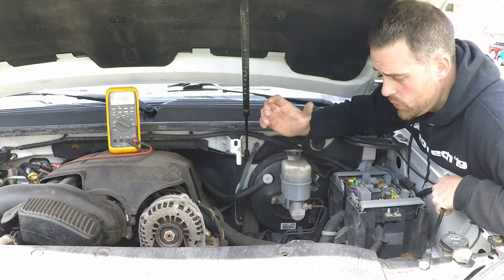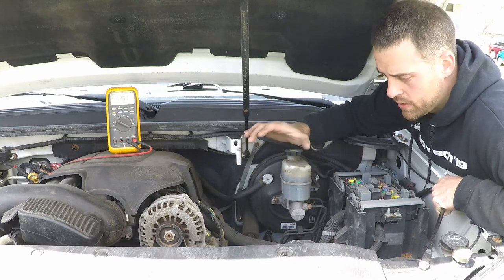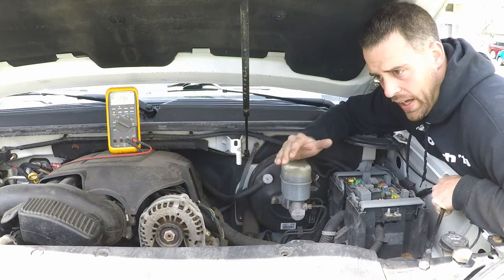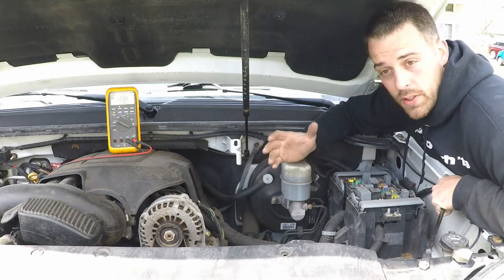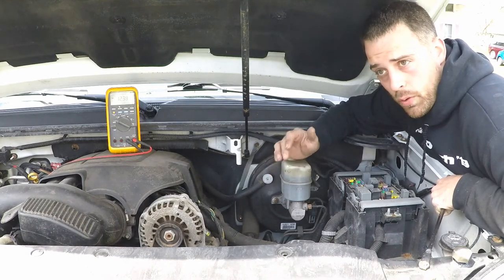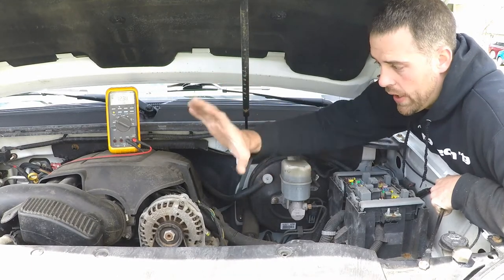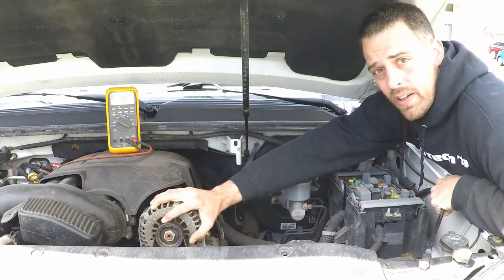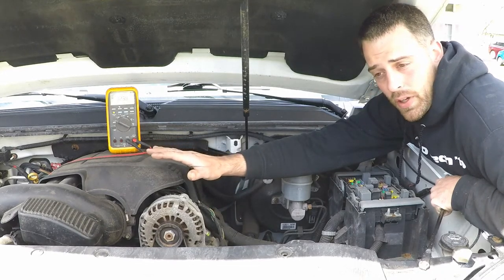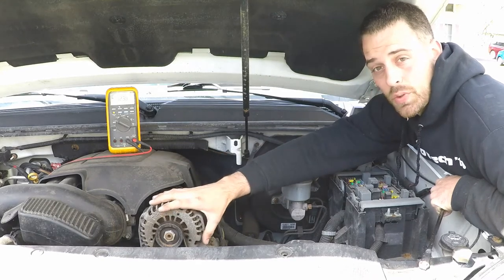So the whole idea is one where the system, the engine, can actually turn off different components depending on the state of the battery. So let's say your battery began to fail, it wasn't as healthy as it once was, or your alternator wasn't as healthy as it once was. What your car can actually do is evaluate how much power is being produced here, and it can say, I know how much juice I've got left back in my battery, and my voltage starts getting closer to that 12.6, it knows that this guy's not doing the job.